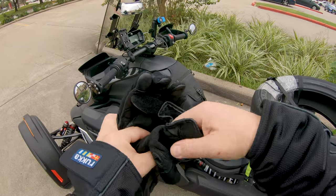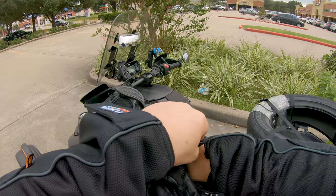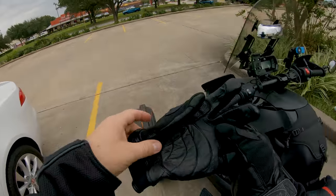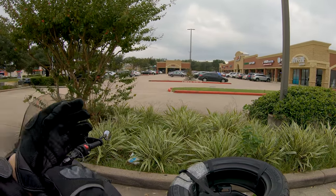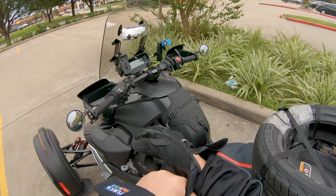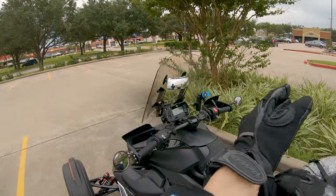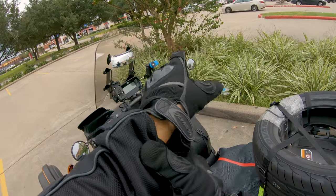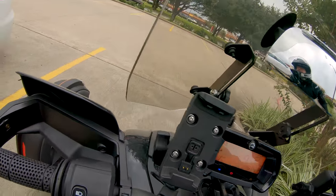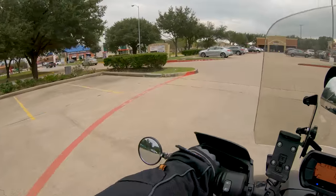The biggest stuff they carry here at Ace is a 1/2 inch, which is kind of what I'd thought or remembered. The only places I knew that carry 3/4 are Harbor Freight, and their selection is pretty thin. And the Sears Hardware store that used to be right up here had some of that stuff. It's always pretty expensive, just because it's not common. So generally the only time you need 3/4 inches is when you're working on trucks, big stuff. It's in the high torque realm, and motorcycles and automotive generally don't get into that. You've got to get into the big diesel trucks and stuff like that. They need high torque fasteners, wheel lugs, things like that. So anyway, it's going to be a hunt.